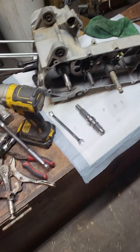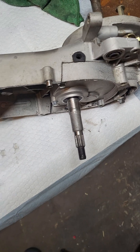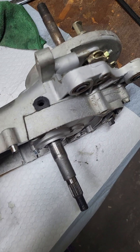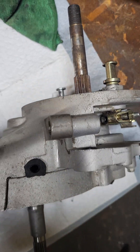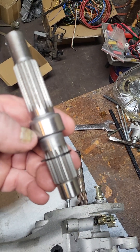What's up, it's me — Scooter Douche, that's my alter ego. Anyway, GY6 150 long case. What we're doing today — I'm building the Ruckus GY6 Ruckus swap. This motor is going on it, and it's got the long axle shaft in it still, so I'm going to show you guys how to swap out the long axle shaft for the short axle shaft.